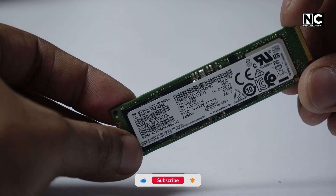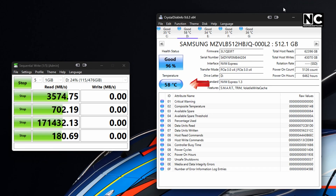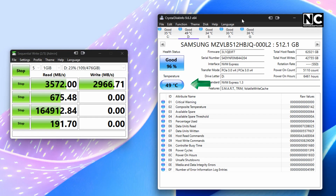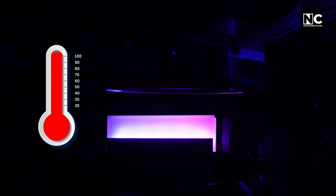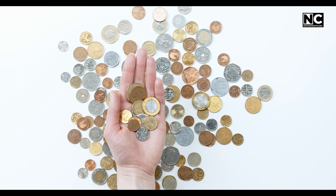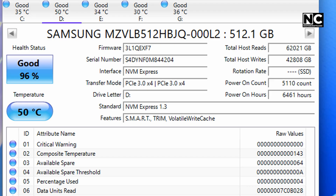Now let's talk cooling, because that's why you are here. Let's talk numbers. I ran tests using a Gen 3 Samsung NVMe SSD that actually runs hot. Without any cooler, the SSD peaked at 65°C under load on a peak file transfer test. With the CM-M2A, the max temperature dropped to 50°C. That's a 15°C drop — not bad for pocket change. More importantly, it prevented thermal throttling. The numbers tell the story.